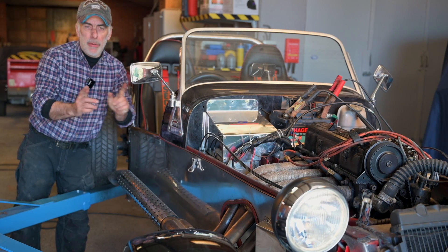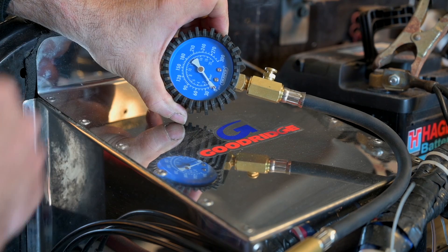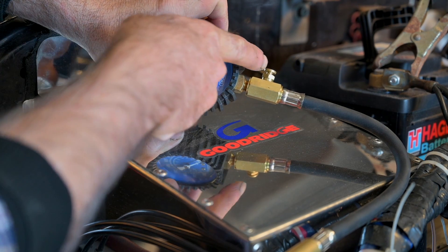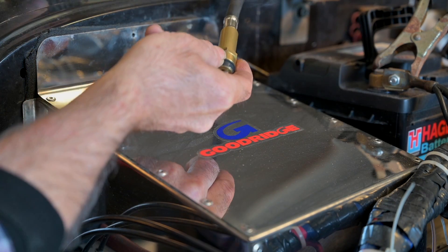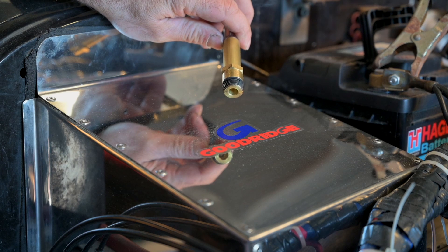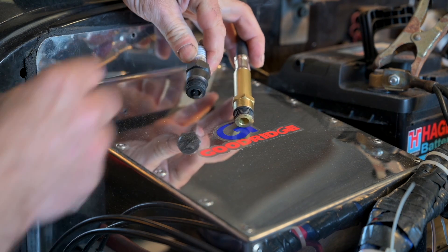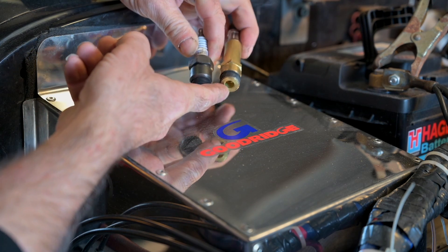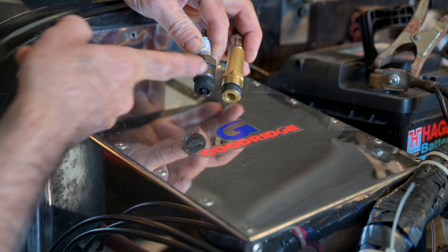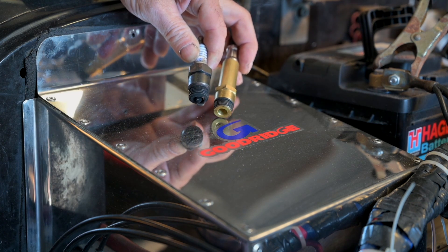For the compression test you need a compression meter. This one gives you the pressure in bar and also in psi, with a pressure release valve. On the other side you have the part that fits into the opening of the cylinder head where normally the spark plug is. The only thing to watch out for is that you have the right fitting at the end. This is my original spark plug — it's just going to fit nice. Make sure you have the seal on, then remove the spark plugs and fit it.